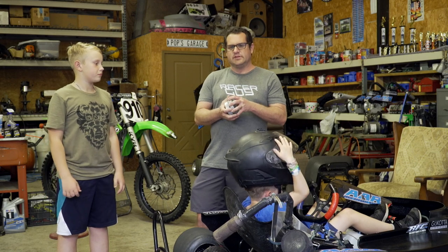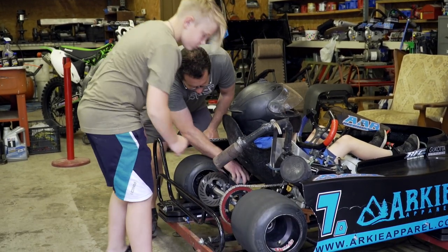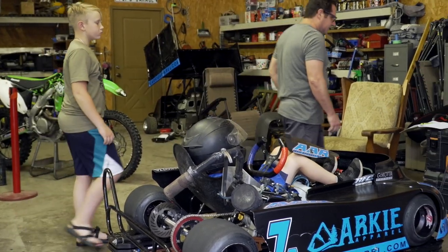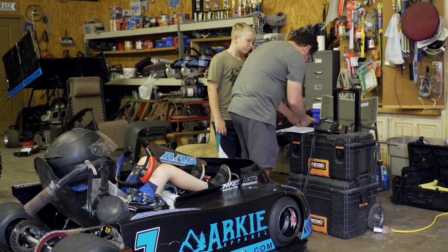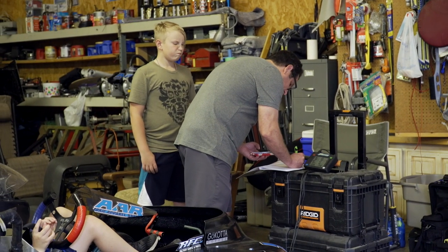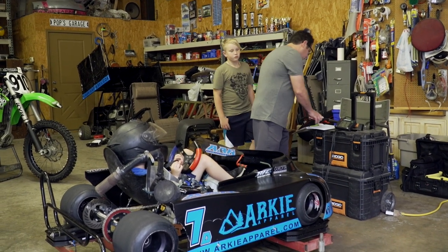So I found this is about 10 pounds of lead. Jay's going to put one on — we're just going to set this on the kart for now and just see how it changes our weight. Let's see if that did anything, because we're probably going to bolt it right here to get some rear. That was about 10 pounds. So now that made it up — that's 51.6, almost 52%. So that's a lot closer.